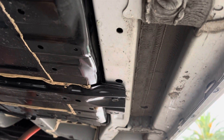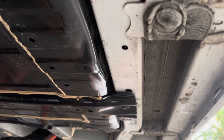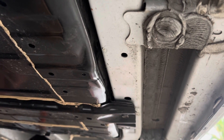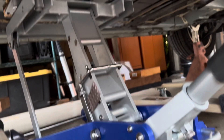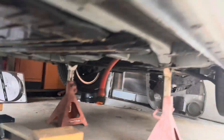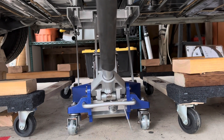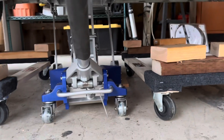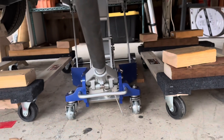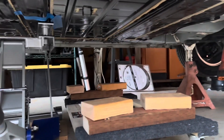Then on the other axis, I put the laser level and had it run from bolt hole in the frame to bolt hole, and moved the battery in and out until the laser was going through the center of the bolt holes. Now, as you jack it up with the lift, because of the physics of the lift, it's always going to creep away from you. So what you do is begin to take it up, and as it creeps away, you keep grabbing the handle down here and pulling it toward yourself. Pretty soon you're able to get one bolt in, and once you get one bolt in, you pretty much have it made.